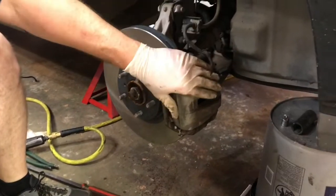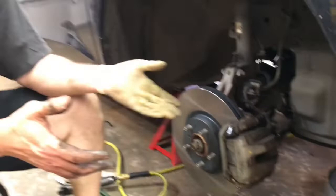That completes the right side — perform the same procedure on the left side to finish the brake job. Once both sides are done, reinstall the tires and torque the lug nuts properly. Before driving, pump the brake pedal until you get a nice hard pedal, then double-check your brake fluid level in the master cylinder. Take it for a test drive to confirm no noises. Thanks for watching — don't forget to like, comment, and subscribe. I also have a new book on fitness and weight loss available on Amazon — link is below. Have a great day!